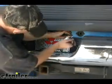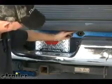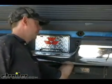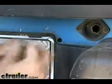We'll use one of the washers that come with it as a guide to mark our hole. Of course you'll want to look on the back side to make sure there's nothing in the way back there. From the other side we'll put our nut in place. We got them installed. The bodies themselves act like a nut, so let's go ahead and tighten them down from the other side until snug.